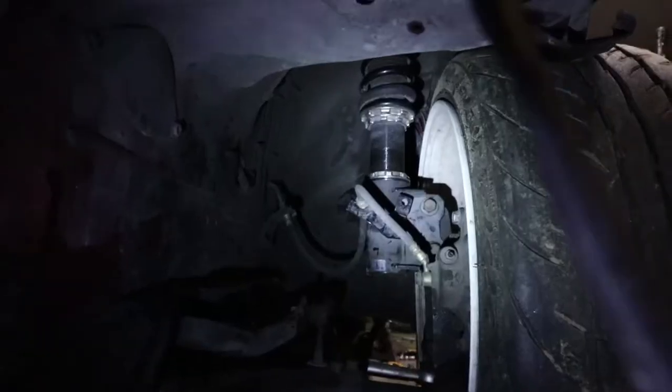So once the tire compresses, that's one of those things that I gotta check out. Once it compresses, is this gonna be way over, and is it gonna be way over on the other side or what? I'm gonna try and adjust these to get the best of both worlds, the best possible flat contact patch to maximize front grip. And make sure that the kingpin angle, the coilover, is straight up and down. Hopefully I'll be super quick with the front grip as well as the rear grip to push the car along. If you guys are running grassroots, better step up your game, because I am.